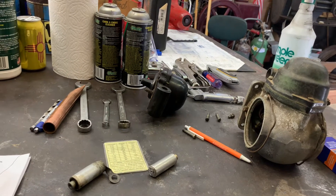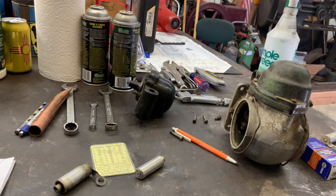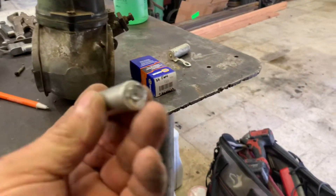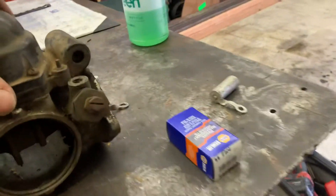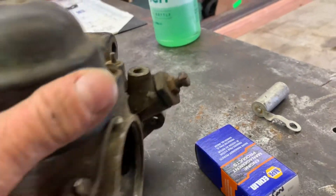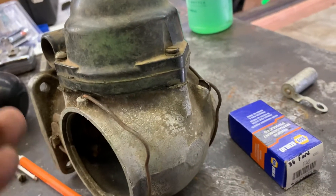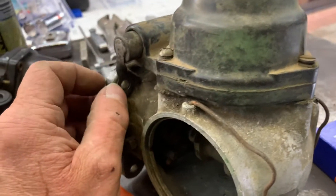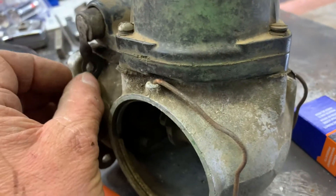I had it stuck in my shop and went out there four hours later and it started right up. So I took this condenser off — unscrewed it from the coil right in here with an 8-32 screw — and undid this bolt. The tab fell off and the condenser stayed there, so this connection had broke. My solder joint had come undone.